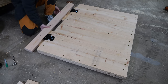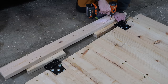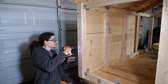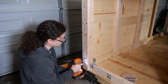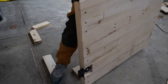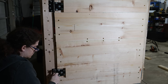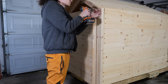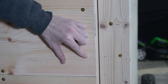Now I take another length of 2x4, the same length as the door. I line it up with the other holes on the hinges so that I can mark them both, then I take out a drill and begin to drill out those holes as well. I take the board I just worked on and I bring it over to the back of the vehicle, and using a bunch of screws, I go ahead and affix it to the back. Then I can take a drill and use the holes I drilled as a guide to drill through the other 2x4 in the frame. I can then take some bolts and thread them through all the holes I just made, pick up the door, walk it over to the bolt sticking out, gingerly lay it on top while hand threading on some nuts, then later go back and tighten down with the ratchet. I then grab another 2x4 that's the exact height of the door, line it up with the other side on the back wall, and put in a bunch more screws. So now we have the door on hinges, and it closes really close to this board I just screwed in, which will be super useful later.